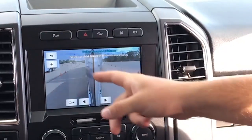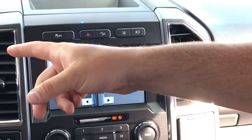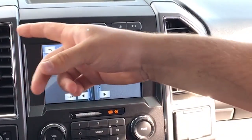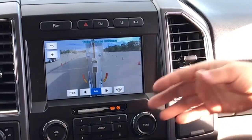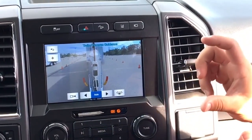Since I selected the trailer cameras, you'll see on the screen in front of you, you have to select the trailer now. You can program up to 10 trailers — you just press OK on the SD. That's the one we named, that's the name we gave to this trailer. You'll see this icon comes up, so it always defaults to this.